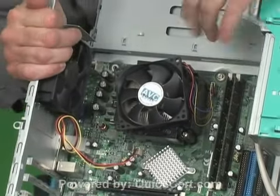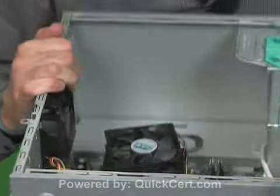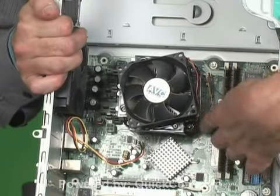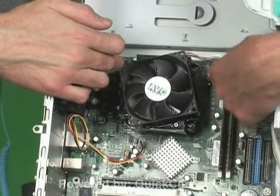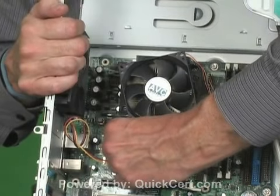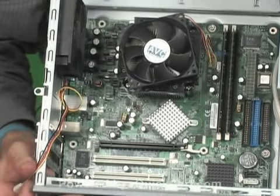It comes around over here, up very close to the processor. I believe that's correct. Nope, I'm sorry. It fooled me. Looking over the top from behind, this actually comes down to the motherboard here. This set of wires is for the fan on top of the heatsink, and it goes down to the motherboard. So let's disconnect this. And now I can begin the process of removing the motherboard.